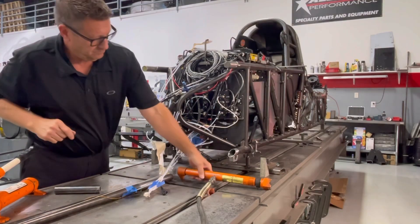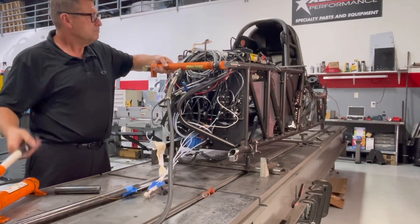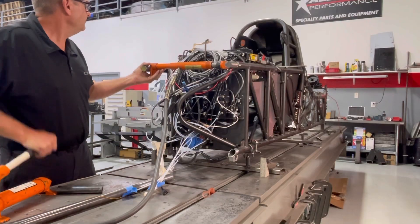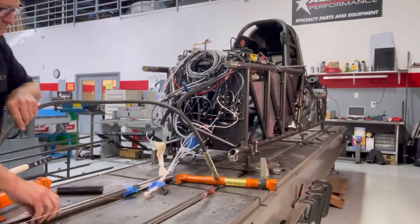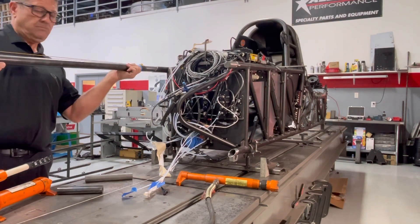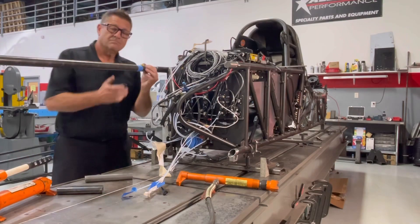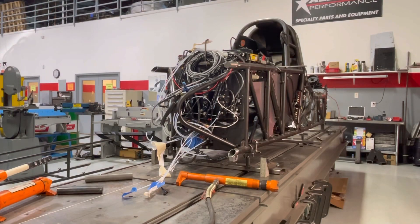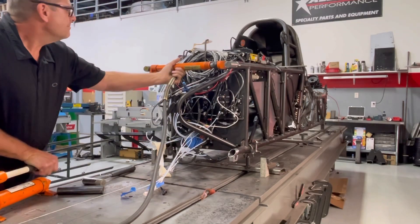You need to fix the issue — these horns sticking out the front aren't going in the right direction. My big issue is that there are manufacturers out there pre-building the front ends when the car's not even there, with fixtures, and they look really nice. But when they go to join these together after they chop the front end off, they're manipulating those pipes, putting them in tension, and then welding them. I believe that is what's causing failures in this class. People will debate it's the 049 thick tubing that's the issue. But there are a lot of cars out there running 049 and they stay straight — the Coletta cars, the Lucas cars, they all look really nice. But as much power as we're asking out of these things, 065 pipe is not a bad thing. This is my opinion — I might not make a lot of friends, but it does work. I've run 058. You have to change your tune-up, but it works, it's safer, it's stronger.